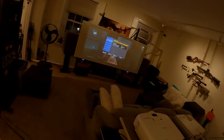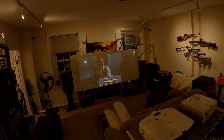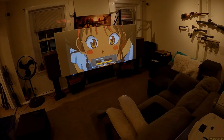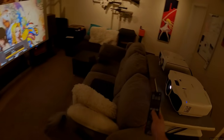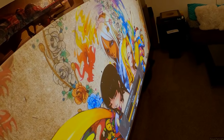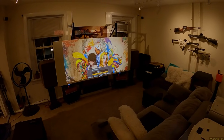Both projectors have infrared receivers in the front and rear so you can control them from any angle. The front one is focused so you can actually point the remote at your projection screen and it bounces back. You can switch between 'normal' HDMI range - which looks brighter and more colorful but loses shadow detail - and 'expanded,' which retains all the detail in the darks. I highly recommend you fiddle with all settings; you can always reset to factory defaults.